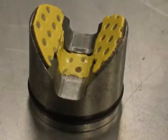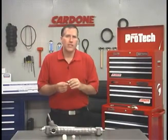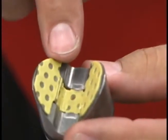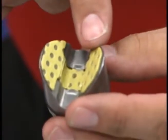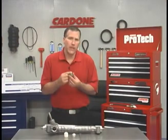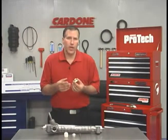The OE yoke design utilizes a steel yoke with a Teflon insert like this one. The problem with this design is that the Teflon begins to wear and the pressure exerted against it causes breakdown and eventually a complete breakaway from the metal yoke. When that happens, the broken pieces of Teflon are loose in the system and there's metal to metal contact between the yoke and the rack but with space between them. Each of these factors lead to noise inside the unit.